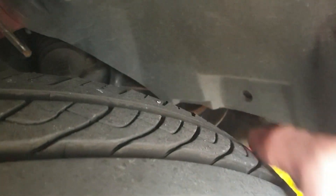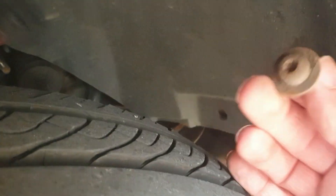So far I've just removed this screw. There will be a screw down here, a T25 style screw. You need to get that out and then we just try and manoeuvre this wheel arch liner so we can just get behind the arch here. The access isn't a massive hole but it's enough to get my hand in there. Also another thing you probably want to check for while we're behind here is rust, because it's one of those areas where it could get quite a bit of moisture in, so you may as well check it while we're here.